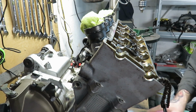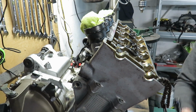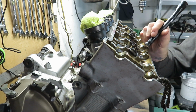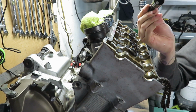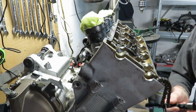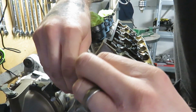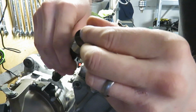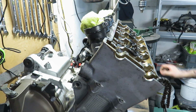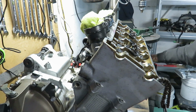And then getting your magnet. Where did I put her? Clean magnet and this one. Take your cup out and inside, oh, it's fallen off. Inside you should have a shim on the middle where that shiny bit is. You've got a shim there. So, keep your bucket to a safe place so you don't lose it or misplace it.